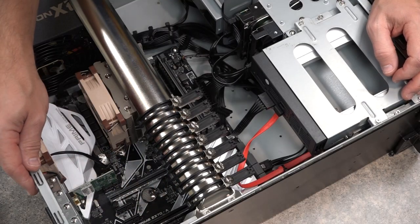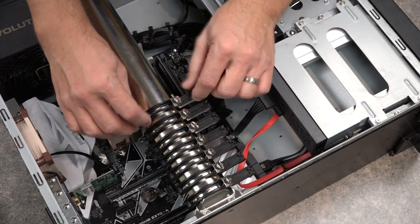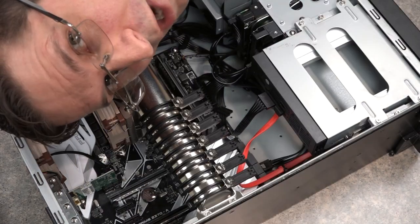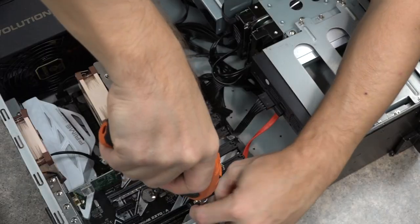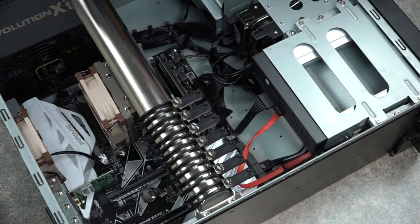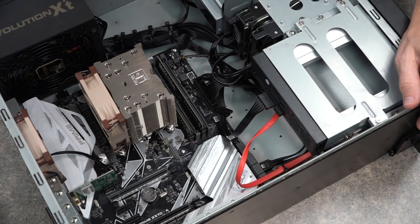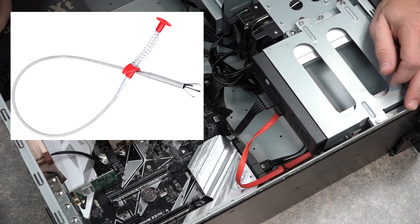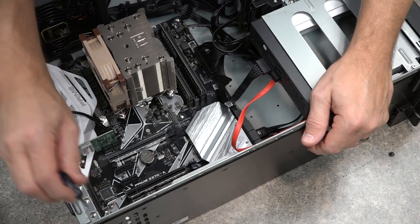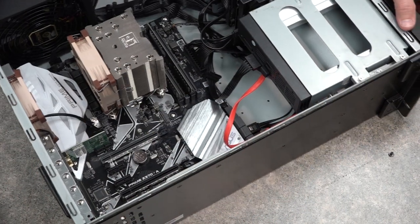Right in here is where our PCI cards are going to go. First thing I need to do is take off this guard right here. I have these little stabilizers right here that you can slide onto those and stabilize the card if you want, but I first gotta take this off. Try not to drop your screws — if you do drop your screws down in there, you probably don't want to use something magnetic because there's all kinds of things in the computer that are affected by magnetism. But if you go to an auto parts store, you can find a little grabber that is really handy at grabbing things in tight spaces.